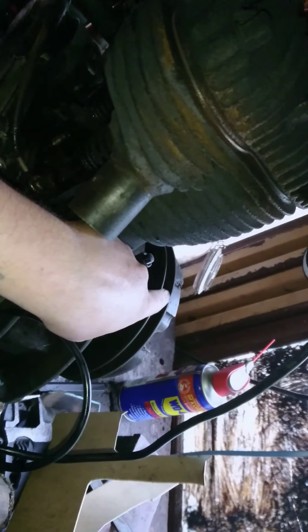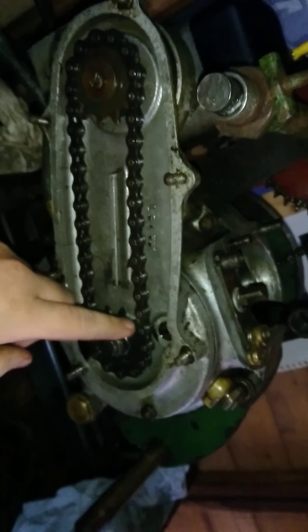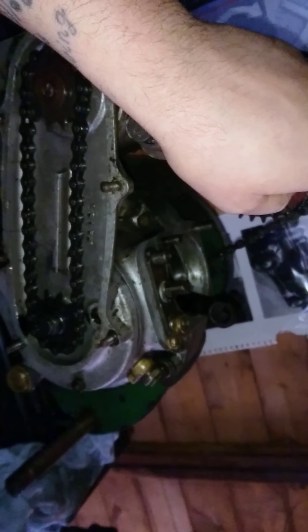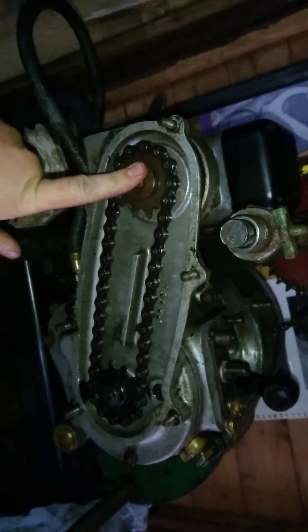I think I've got a pair of new old stock shoes for your centrifugal clutch. This magneto has also been part-cleaned and rebuilt. Finally, I set your timing — you set it to an eighth of an inch before TDC, let your Wico mag fire, and then turn it back.